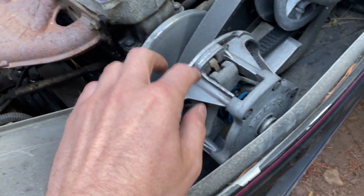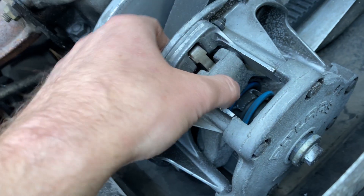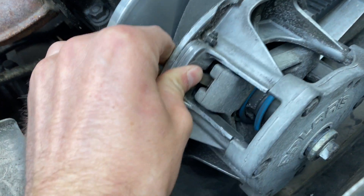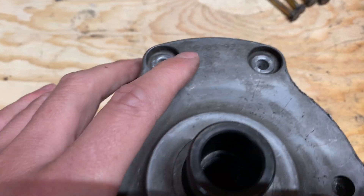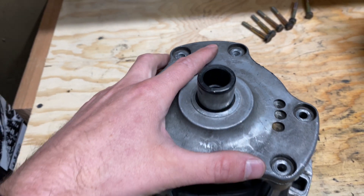The spider is also different on this clutch. This part right here is called the spider — you'll see how it's flat, and it's just not quite the same as what we're going to see in the next clutch. You can see from the date stamp on the top it was made in late 1999, so it was probably sold on a 2000 unit.